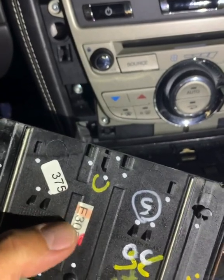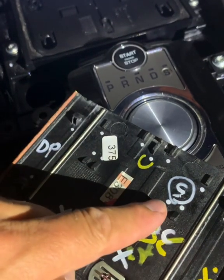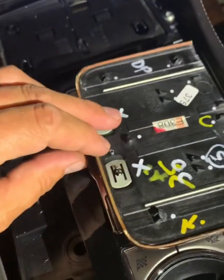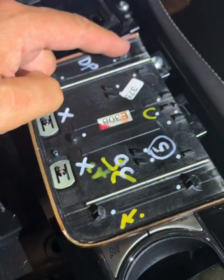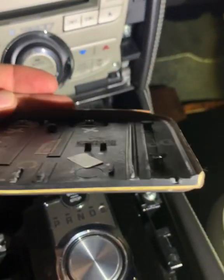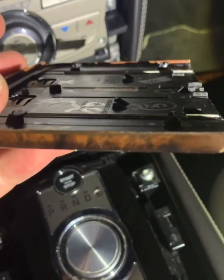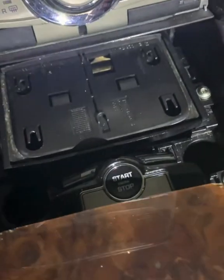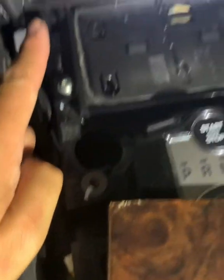Those little tags there are the reasons, 2 on each side, 2 there and 2 there. They are the reason why this does not come off. If you have a look, there's 4 little tags there, 1, 2, 3 and 4, and they're just little round, like notches, if you like. Can you see them? They're little tags with notches at the front. When you turn it upside down and push it forwards onto the tray, they drop down into there underneath that little tag, and then you slide forward and then they locate.